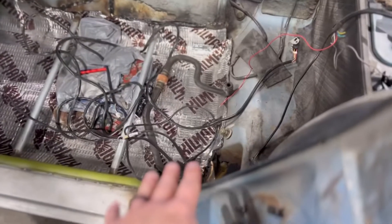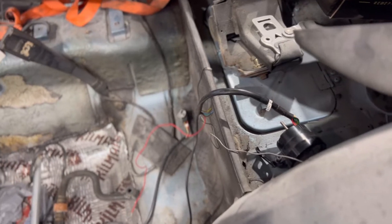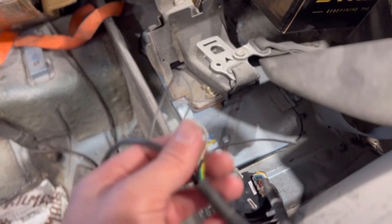We still have access to our plugs for tuning. I also have my wideband gauge I have to get wired up. I believe that white wire is the 0-volt to 5-volt output, and that'll just allow the ECU to see what's actually going on with our O2 sensor, our wideband gauge, and it can adjust AFRs from there.